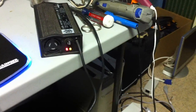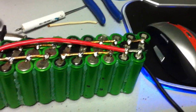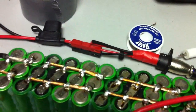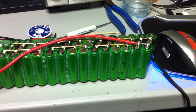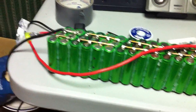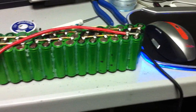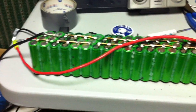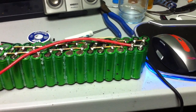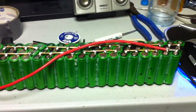I got the battery wired up and temporarily hooked up to a charger just to put some voltage into the pack. It's holding 41 volts and it's charging fine — every one of the cell groups is sitting a little over 4 volts, so everything's going well. I have to order my balance leads; I'm going to be putting balance leads on all 10 of these cells as well as the next pack. I also need to order some heat shrink. This is going to be the configuration of the first pack, and once I can get it back on the bike with the controller, I can figure out how to design my second pack and fit it in there properly.